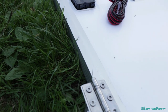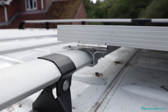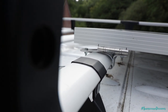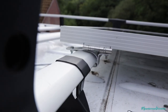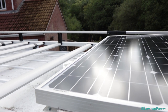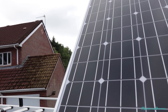It's all looking good, so the next stage is to lift them back up on top of the van. The panel is now attached back onto the bars — we've put the u-brackets around underneath the ulti rack, and the hinges are sitting on the outside. It looks really good, and the panel also tilts: if we lift up this end of the panel, as you can see it tilts nicely on the hinge, so you can angle the solar panel towards the sun.